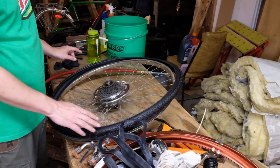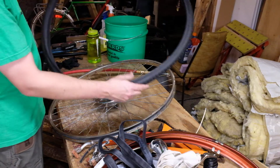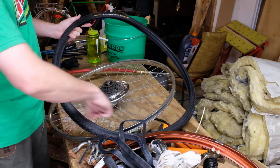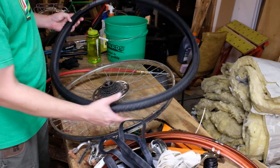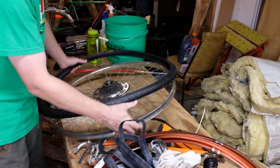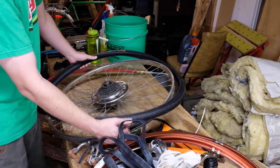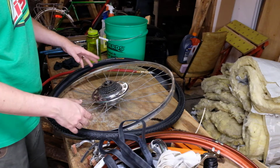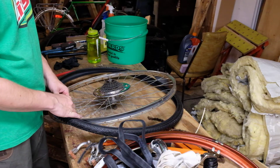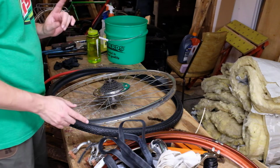This one I happened to luck out, and a local bike store had this one. This is a Continental Ride Tour, which appears to be a pretty stout tire. One of the things that is useful to have is an actual wire bead on this. In other words, something that you can't fold up. And the reason for that is there's no lip on the inside of the rim as many rims have, and therefore if you inflate a tire too much that doesn't have a solid bead like this does, it'll kind of roll its way off the rim, which is not catastrophic, but it is startling.